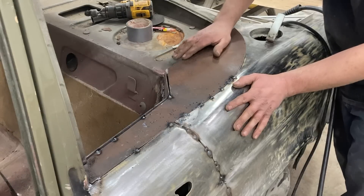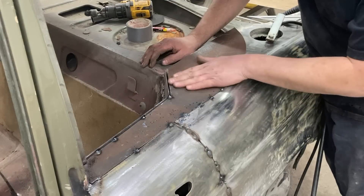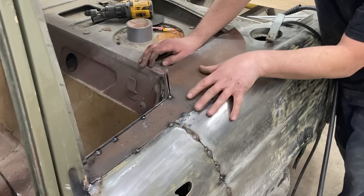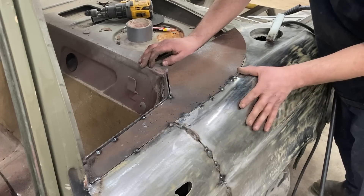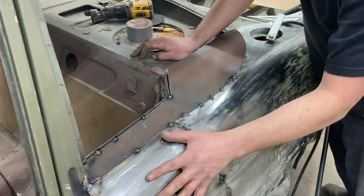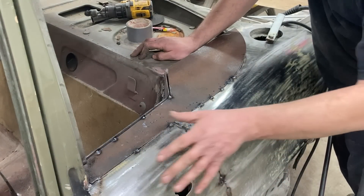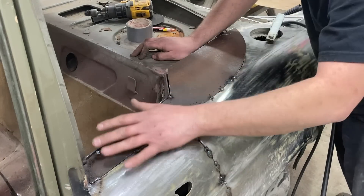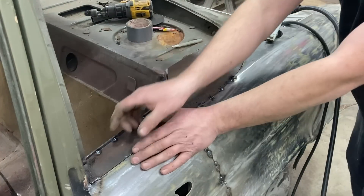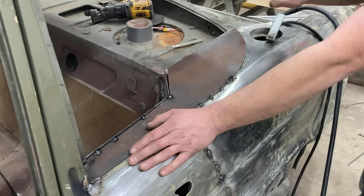I think we may have to cut it. The whole time I'm doing this, this is locking the side of this car together: my quarter panel, the back of my body here, my pillar, the new door piece I put in - and remember that's got that little frame in there. All that and the big piece of frame I welded here. This is really tying this together now. Then we'll do a window frame and take tubing right across here, and that will all become part of the car.